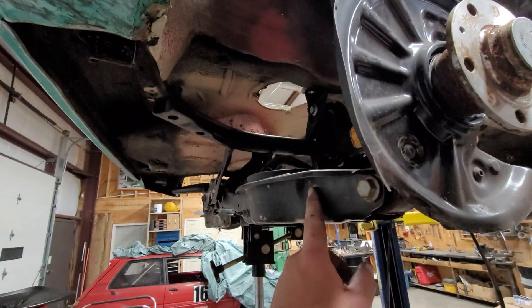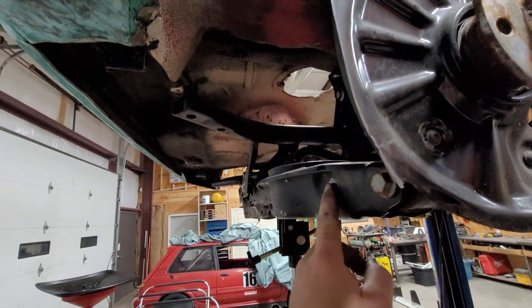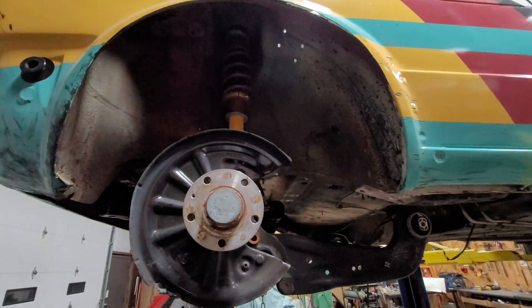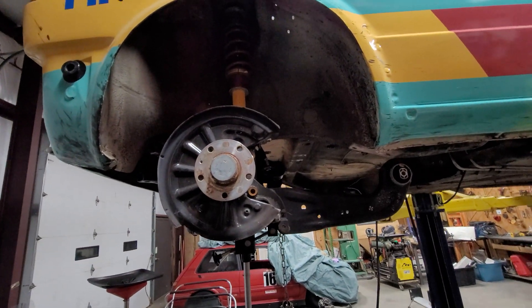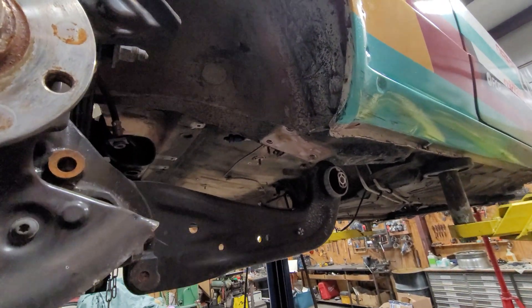I'm not seeing anything that's a deal breaker. The suspension, instead of being here on the twist beam, is more rearward, but this whole area is going to go away anyway. I'm hoping to use just factory MK7 front suspension and rear at this point, because the Audi TT stuff is interchangeable with the MK7 GTI and whatnot. All good things — I think it's going to work. It's just a matter of getting here now and spending the next evening just chopping stuff up.